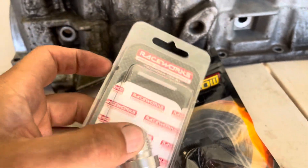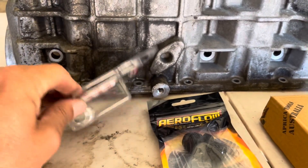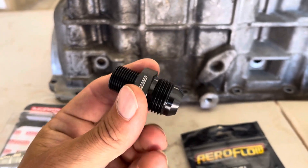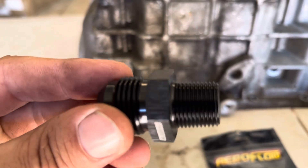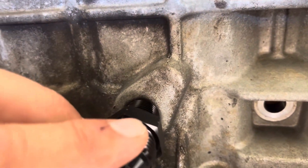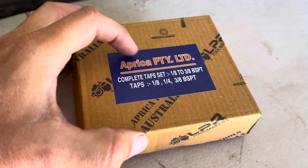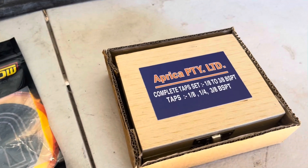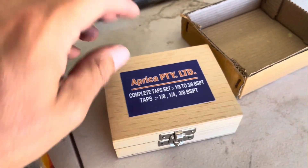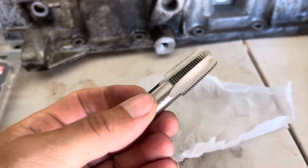My original plan was to have a bung welded onto the outside, which I've seen people do. The whole plan is to do as much of the work on this car as I can myself, so I'm not going to go that route. I've decided to get another fitting - it's a dash-10 AN fitting and it's got a 3/8 BSPT thread on there. I've roughly guessed the size of the hole and it worked out almost a 3/8 BSPT - a little bit smaller, it doesn't quite fit in there yet, which is good. I've gone and bought a BSPT tap set. I could have gone NPT - a lot of people use NPT - but I've worked on Nissan Patrols in the past and they use a lot of BSPT thread, so that's why I've gone this route.